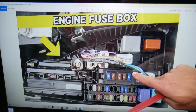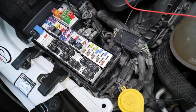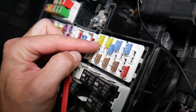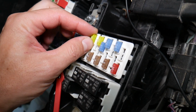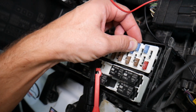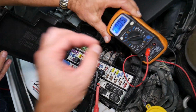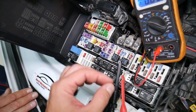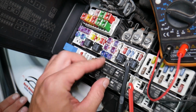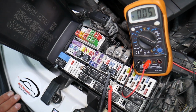Before we continue guys, let's explain quickly why it's always a good idea to test fuses and relays. So let me explain why it's super important guys to test fuses. Fuses, not often can you see if they're burnt or they're good. Sometimes they may seem perfectly fine, you think it's a good fuse, you put it back in and you end up spending money and time on parts and problems that do not exist guys, when all you had to do was test your fuse, find out it's bad, replace it, fix your problem. So we will have a video on how to test a fuse, different kinds of fuses, and how to test relays guys. We're going to put the link in the description of the video below specifically to that video.